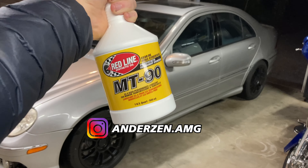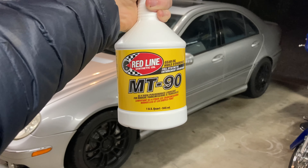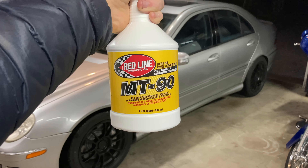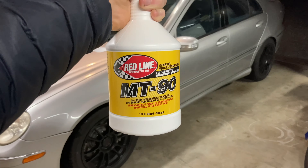What's going on, you guys — changing transmission fluid out today. I'm going to show you guys how to, but more importantly I'm very curious about trying out this Redline MT90 because the reviews online are saying this is the go-to for manuals. I just put the transmission in — the fluid is fresh, but the transmission had been sitting for a while, so I pre-planned to run the fluid for a little while and then take it out, just in case there's any gunk left. So we used that Valvoline MTF, which I think is possibly a GL4/GL5 combination.